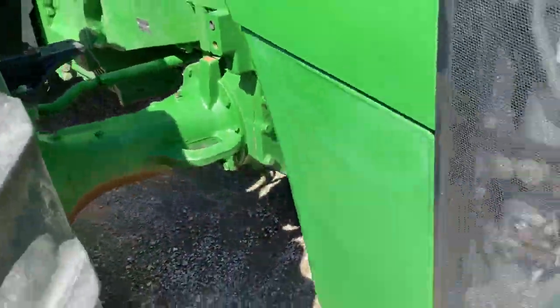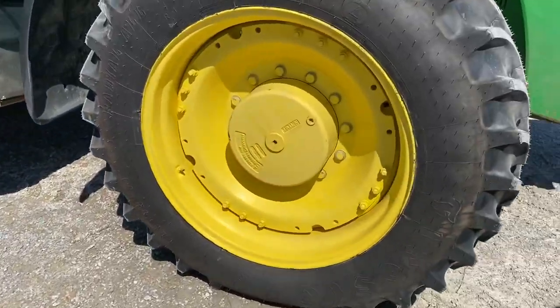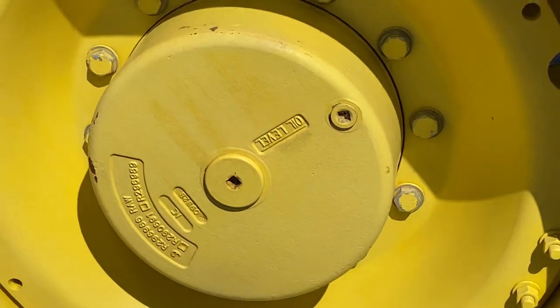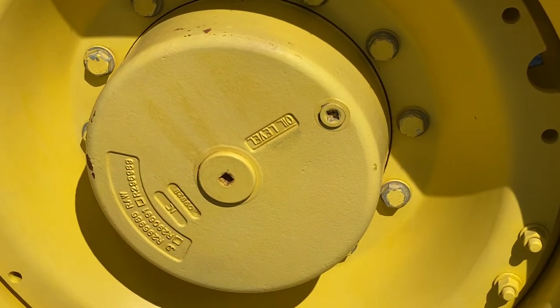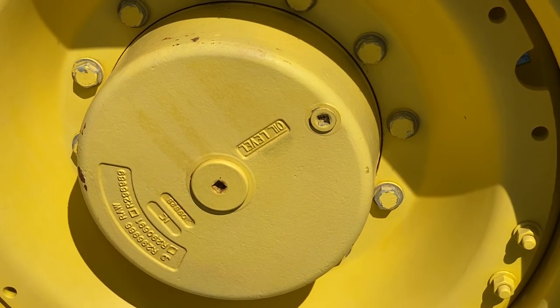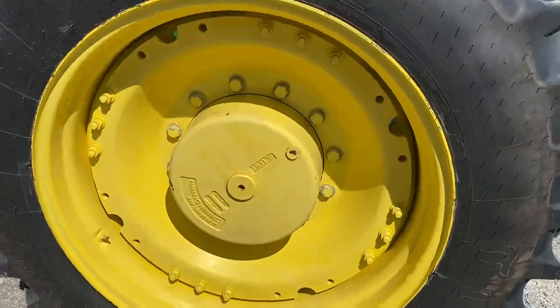So that's the late 1300. This is the 1500. The hub looks the same as the ILS, because it is the same hub. From the knuckle in, it's completely different. It's got a hole with the plug there on the end — the large plug in the center. That's how you can tell the 1500.